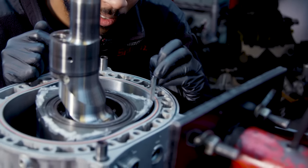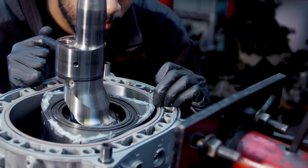That's one of the reasons why we advise pre-mixing — just adding a bit of two-stroke oil to your fuel tank when you fill up. It just helps prolong the life of the apex seal more than anything else. So with the springs in place, we just slide it right down to the bottom.